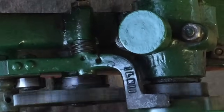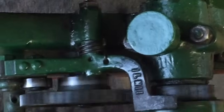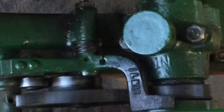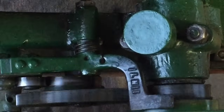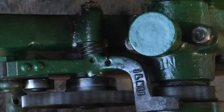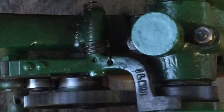From this angle you can see the governor eccentric, the cam, the cam gear, crank gear, and the latching assembly, which is latched or unlatched by way of the movement of the governor eccentric. You can also see the pushrod roller at times following along the cam.